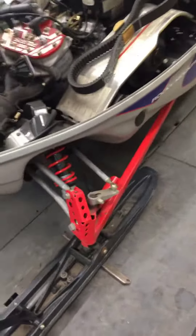The other issue on this side is the drive belt — it has got quite a few little heat checks in it. It's not really going to hold on too much longer; I would like to replace that right now while we're here. The spare belt looks like it's fine — we can put that on if you want, or we can put a new one on, whichever you prefer.